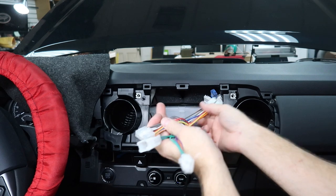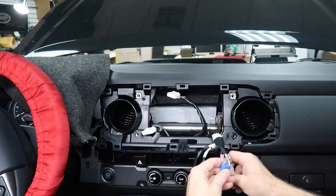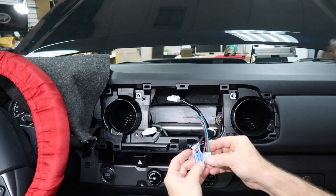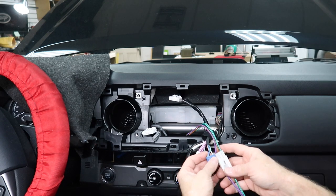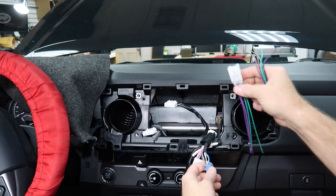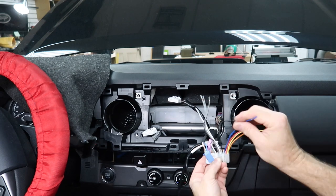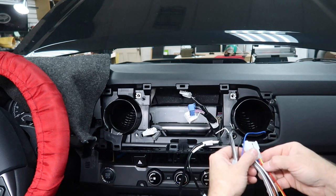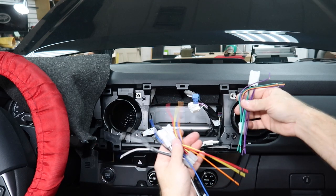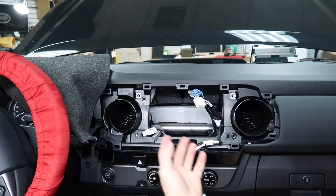This will go here, this will go into the back of the radio, and that allows us to do this interfacing without cutting any of the plug. We want to make sure we have all the wires we need in these harnesses because they don't always ship with the right wiring. In this case, this has a brown wire here but the reverse harness doesn't, so I'll have to find a wire to clip in. On the other one, it doesn't have this blue wire, but this one does — I'll take that pin out and re-pin it so I have all the matching wiring I need, making sure everything passes through to the radio except the speaker wires.